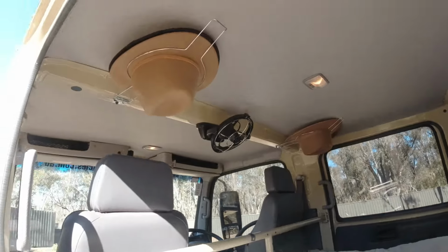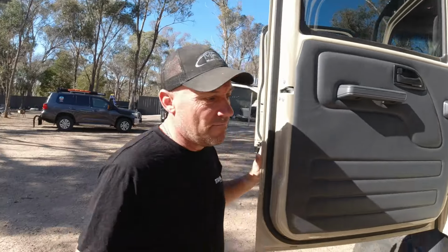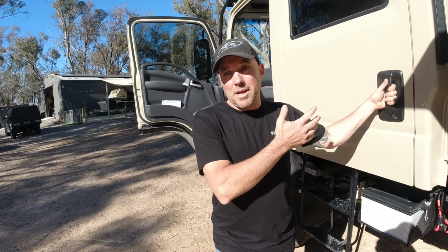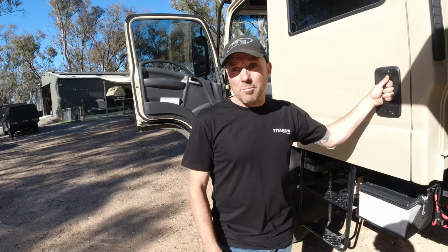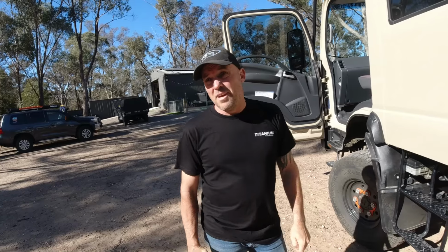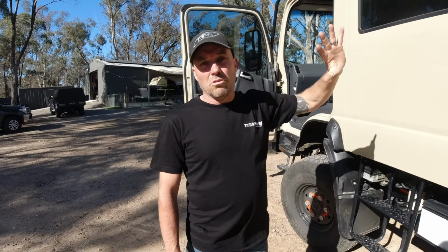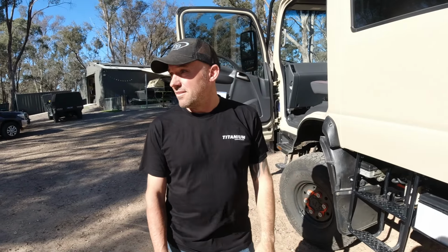And you've got your hat racks up there. And the whole inside of the cab, they don't come with anything, just that vinyl floor and nothing else. So when we got it, we fully stripped out the inside and sound deadened the whole thing and insulated it. Car builders do a kit for these trucks, so it comes all pre-cut. That was a fair effort. We did the floor, the roof lining, the back wall, and it makes a huge difference for temperature and quietness.